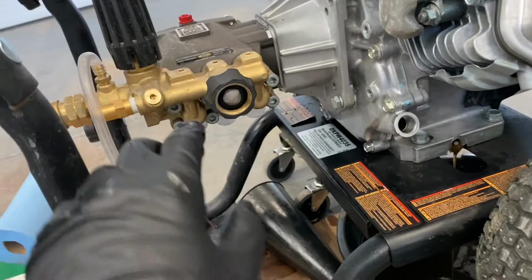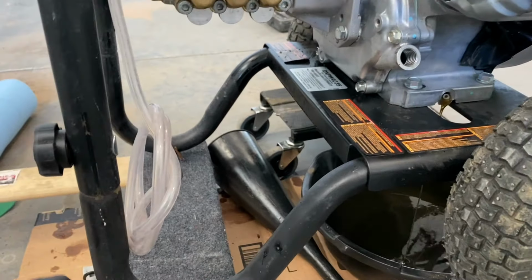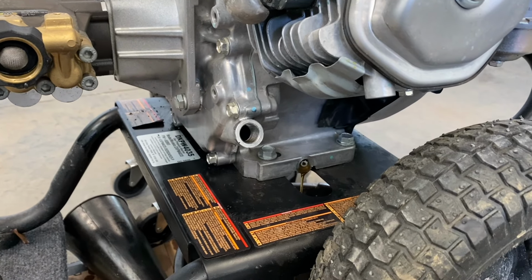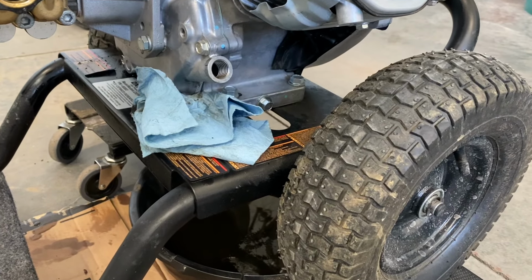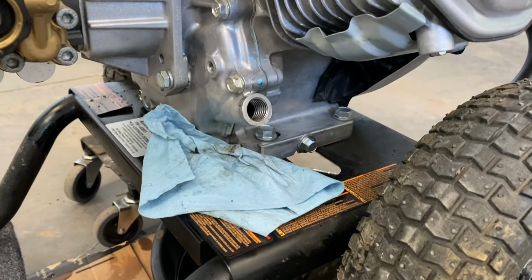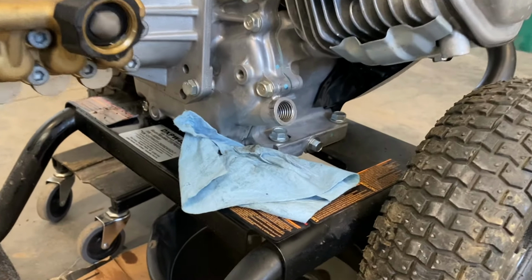While that's draining, I'm gonna go ahead and make sure there's, you can see I had it hooked up. Make sure there's no things hanging on the edge of my screen there. It's always a good idea to clean those up. And that little guy was hanging on to his oil for dear life. Let him finish till he's down to just a drip. Okay, we're done draining. I've gone ahead and put the drain plug back in and just tightened it back up, and put a rag underneath that fill port. I'm gonna grab my oil, walk around to the other side of the machine,